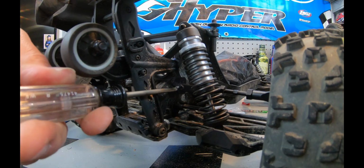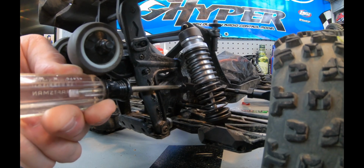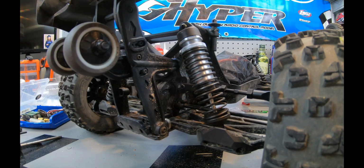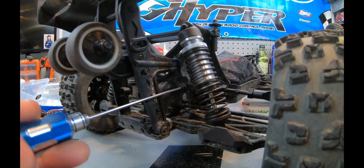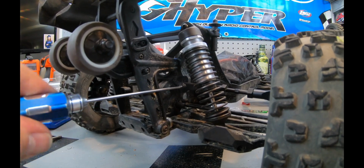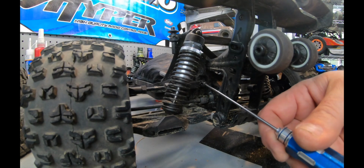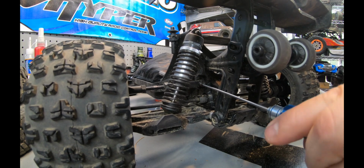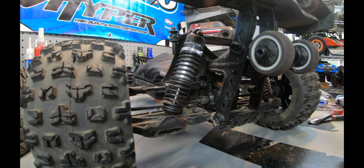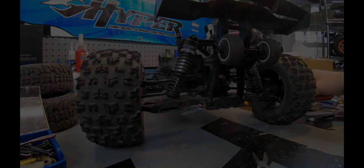Watch your ears, because I'm going to give it a couple taps. So make sure you leave your upper links in the lower position, not the full upright position. Because if you don't, it's going to change the camber to a bad position. Good thing I checked that. So don't change your lower camber. Don't change your upper links thinking that you're going to lessen squat camber, because you increase full extension camber to where it actually binds on the arm. So that's no good.